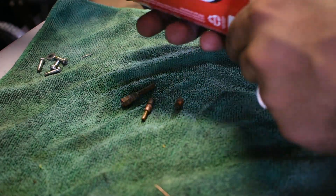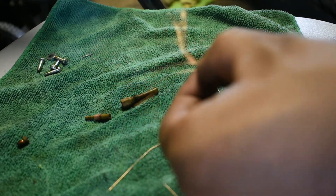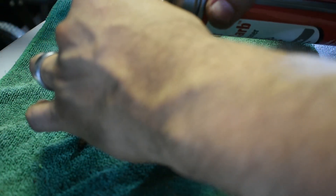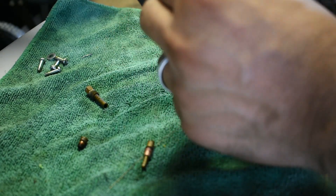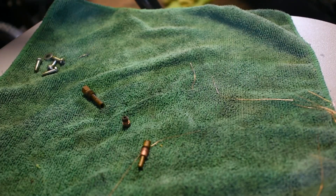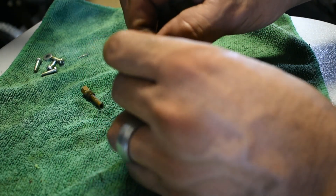What we're going to do is use a piece of wire. To clean these carburetor jets, we're going to use a carb cleaner — we're going to spray those things. I got some wires. You just cut a wire that you had laying around the house. Spray the eyes, and be careful with your own eyes. Use some safety glasses — you don't want carburetor spray in your eyes. Get a piece of wire. If it's too skinny, you can put two together. Then just go through the little eye right there, and start pushing through after you spray some carb cleaner.